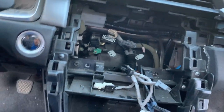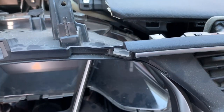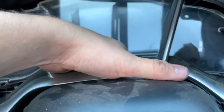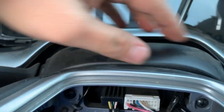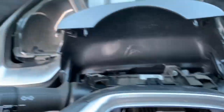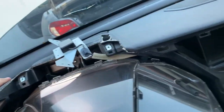Once you have the radio out, there's what I think is a GPS unit — unscrew that and it'll come out. Then take off the top piece of the instrument wheel cover, stick your hands behind it and pull it right up. Once that's out, if you have a start/stop button like this one, unclip the connector, and also disconnect the hazard lights. This should come straight out.